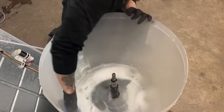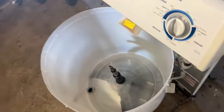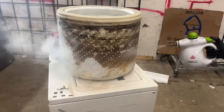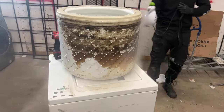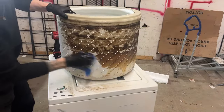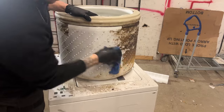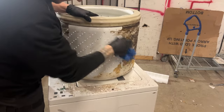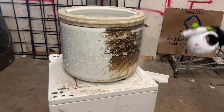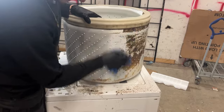In case you're wondering what causes this to happen, it's actually fabric softener. I encourage you to stop using fabric softener — it is not good for your machine. Cleaning the inner tub is significantly harder and by far the hardest part of this video. I highly recommend that you use a steamer to soften the dirt and debris built up on the inner tub. I've left links for all the tools in the description below. Once you've spent a few minutes steaming the inner tub, use a fiber with a relatively aggressive texture — I recommend an SOS pad.